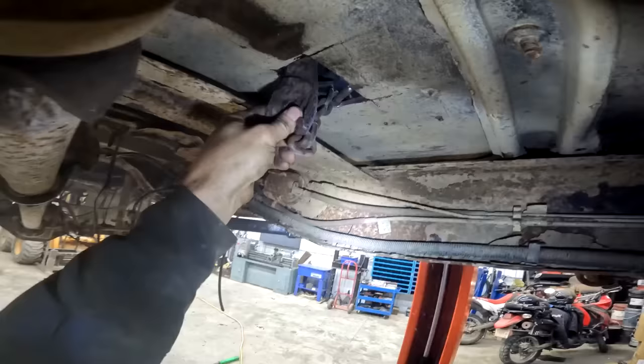Mint. A few guys have asked me on the old interwebs about how much engine oil to diesel ratio I run in the old Fords in the wintertime. Well, if they're sitting outside all the time and they're not in the shop staying warm, I don't want to go much more than 20-30%. But I figure I should do a video on that. I don't actually know for sure. So I reckon I should do a video on how much you can dilute the engine oil. And in the summertime, you can run straight used engine oil. I've been doing that for years. But in the wintertime, it's a little thick, and it doesn't like to light off at all.